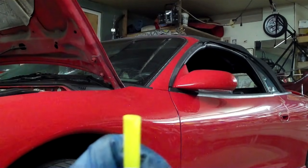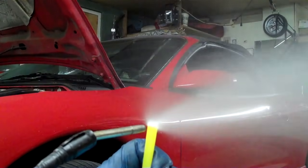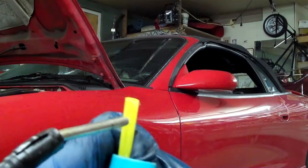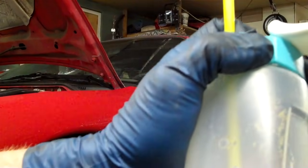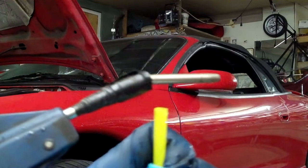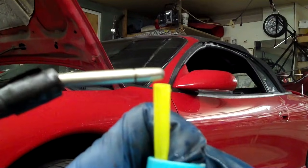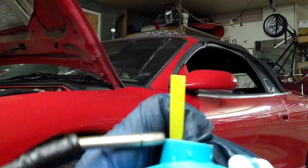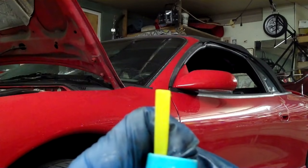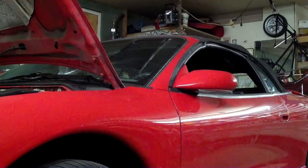The different sized straws are like your different sized jets. When you have lower pressure air moving over it, it's not quite as dramatic, but kind of fun. That's the Venturi principle — it just sucks the water through the straw because you create really low pressure, a vacuum right there because the air is rushing across. Air sticks to itself just like water does. As you go across the top it drags air out with it, creating a vacuum that pulls the water in. The water has surface tension and it pulls out too — it's all connected like a chain.